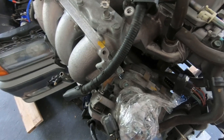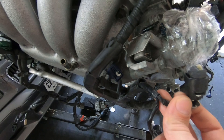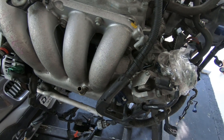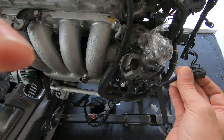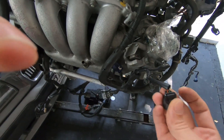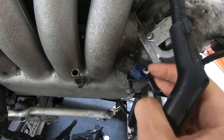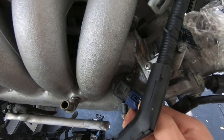I say keep drive-by-wire. Moving down here there's a little solenoid that's been broken in my case — I won't need that because I'll use drive-by-wire throttle. This connector here goes into the intake for the intake air temp sensor — we'll keep that. And right down here you can see the MAP sensor — you'll definitely be using that, so go ahead and pull that off.